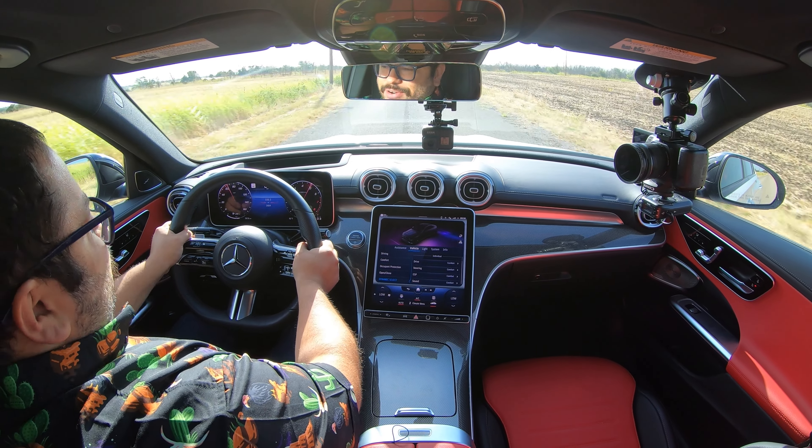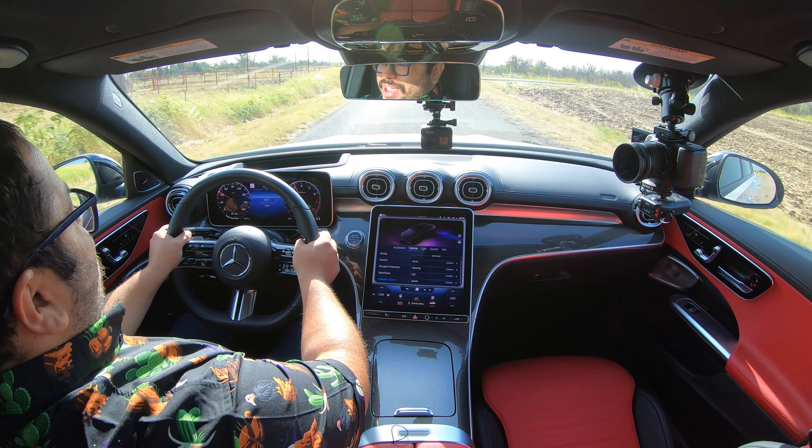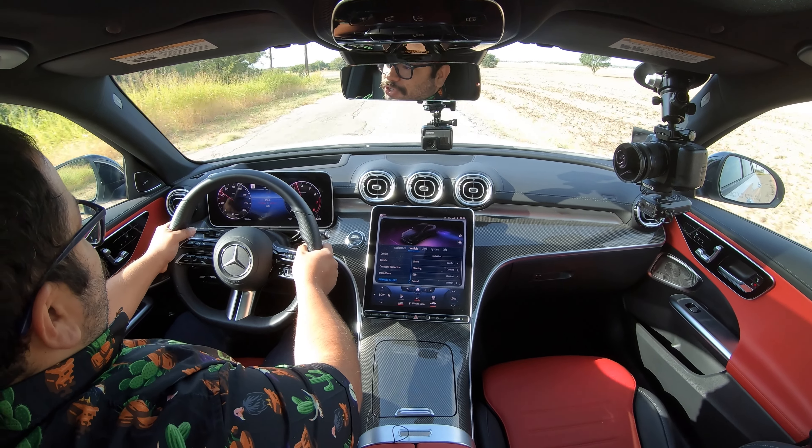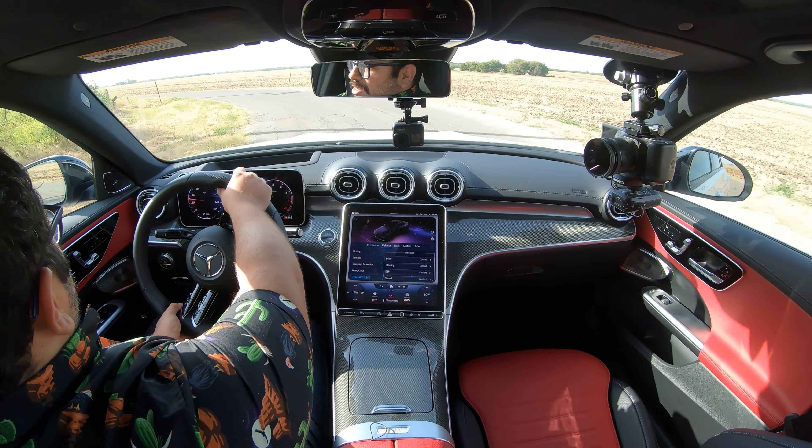The only thing that kind of scares me with this is the brakes. The pedal isn't really giving me any feedback until I'm halfway down — that's crazy. I'm halfway down on the brake before I feel feedback. I know what brake boil feels like and it's almost like that. I don't think it's a manufacturer defect or burned brake fluid situation — it just feels like you put it down halfway and then it starts kicking in the pressure on the pedal. I do still have pressure, but I don't like that feel. The 4Matic mid-corner turning was great, though — good on you, 4Matic.